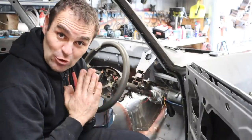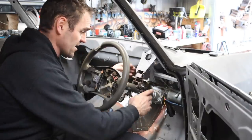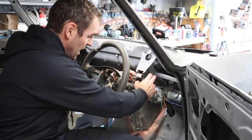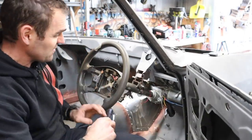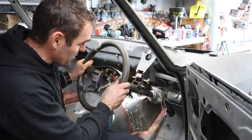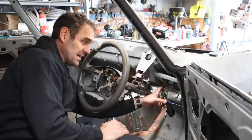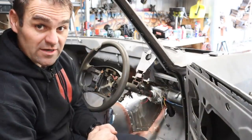This is coming along quite nicely. I took a piece of square tubing, cut it in half and got two nice L-brackets because I didn't have any angle iron that size, and mocked up a couple of mounts. They're tacked in now and the steering wheel is sitting in a great spot. The only thing is the far end moves quite a bit, so what I have to do now is make a mount on the power steering motor — the electric motor back here. There's a hole there, so I'm going to cut up another couple of bits of angle iron and get this thing all connected up.